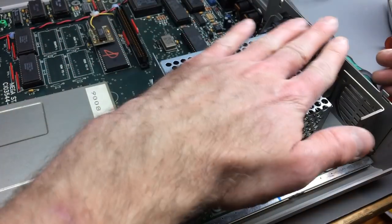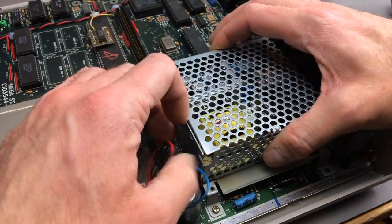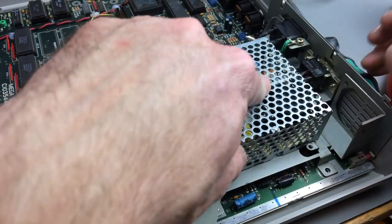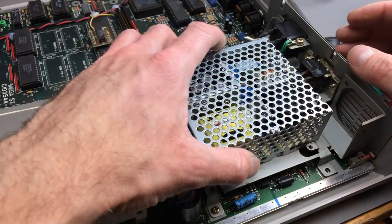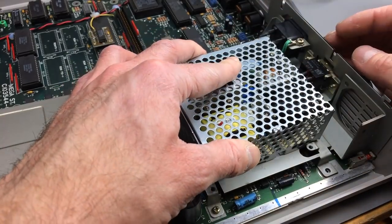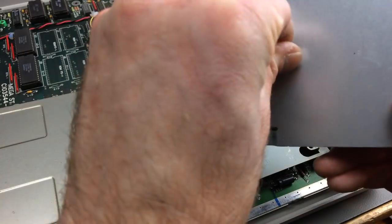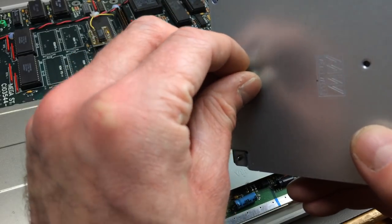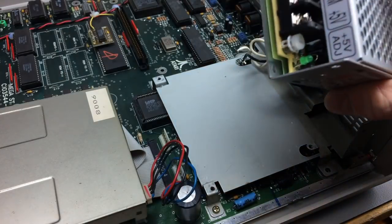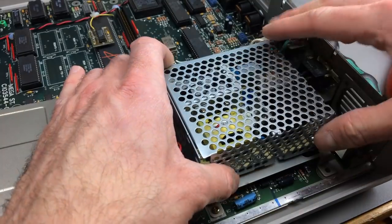This actually fits very nicely in here. It just fits beside these terminals here. If I take out this insulation layer here, because the case is ground anyway, the only thing we need to do is make some holes to screw mount this on here. Then we can mount it from the bottom. It has two screw holes here, which probably even fit the old screws. Yes, absolutely. So we can reuse the old screws there. And I think I want my screw terminals on this side, facing inside.